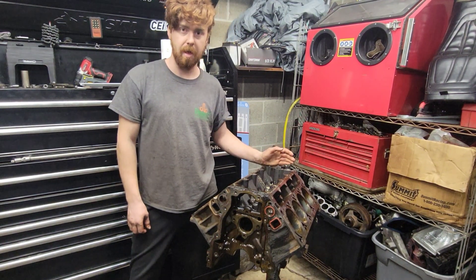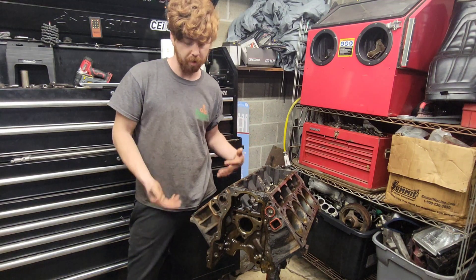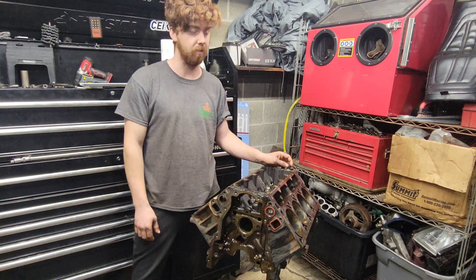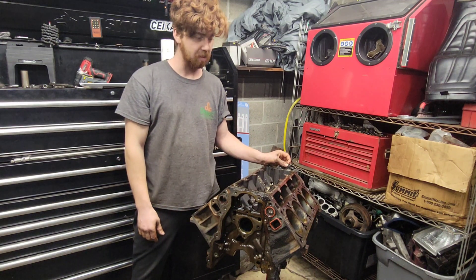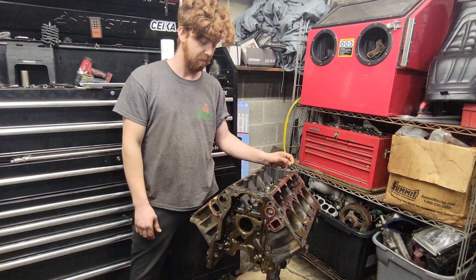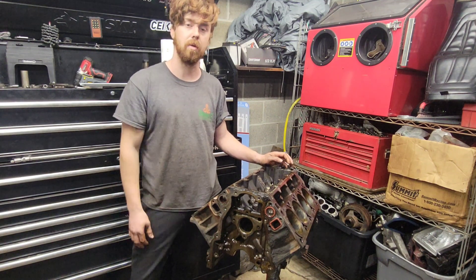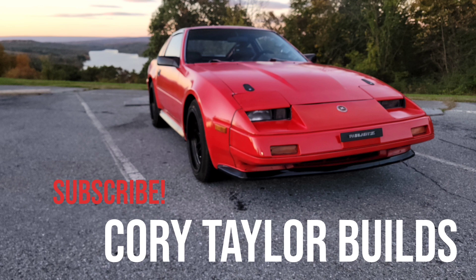This poor motor ended up breaking a valve spring, which is very common in these motors. Such a simple repair — you get a valve spring changer tool to do it while it's on the motor, put air in the cylinder, super easy to change out. But they pulled the motor out and sat it outside to rot away. This could have been fixed. There were no issues with any of the bearings and the heads were actually super clean. Check your springs if you ever lose compression in an LS engine — they always break in a certain generation. Definitely got some decent parts. I can probably sell this block for 50 bucks as a core and put a new spring in those heads and sell them for 100 bucks. So I definitely made out for my 75 bucks. Thanks for watching — make sure to subscribe if you haven't already. Have a good day.